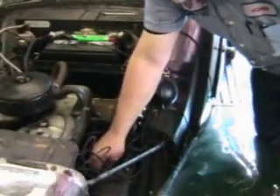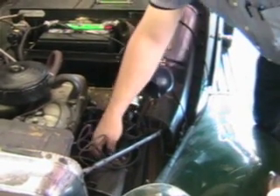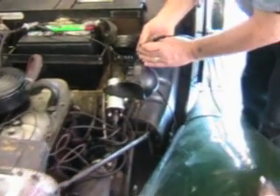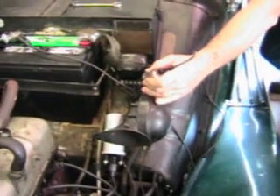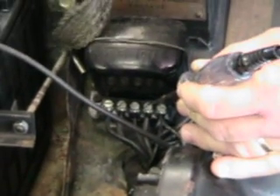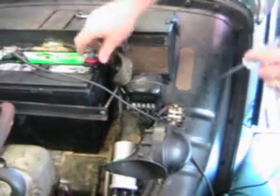But let's say the charging system isn't working. I'm just going to pull a wire off the back of the generator so that the charging system doesn't work and show you what happens here. We've got our ignition warning light here, and I'll start the car up. We still have our headlights on. The light stays on. And if we take the lead off the battery, it kills — which means it isn't working.